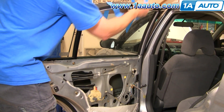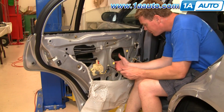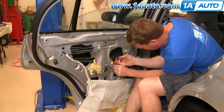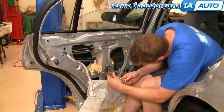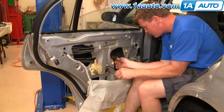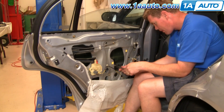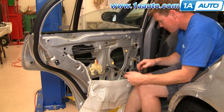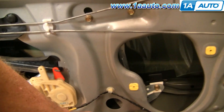Remove the tape and let the window slide down slowly. Get the window into place and start one of the bolts. Speed it up again as I thread those bolts the rest of the way in and tighten them nice and firm. Note: the bolts that hold the window to the regulator are the longer bolts — use the shorter bolts for the motor and the regulator rail to the door. So your motor is all remounted and tight, and the bolts for the rail are tight.